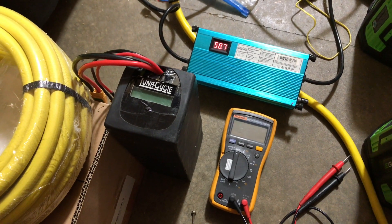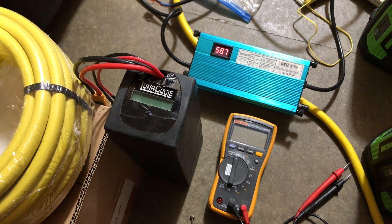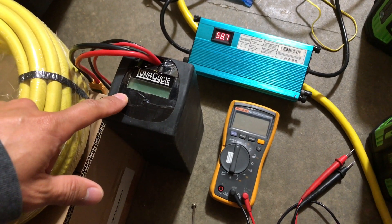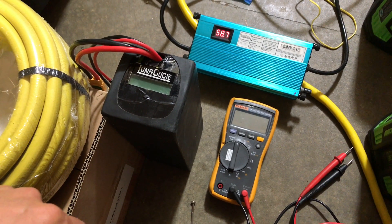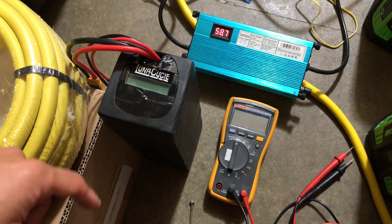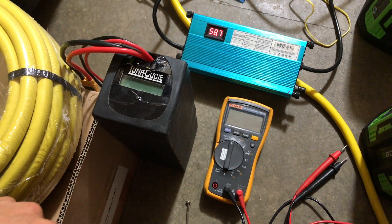What we're going to do today is find out if the M600 and the LunaCycle X1 will take a 52-volt battery. What we have here is a LunaCycle battery consisting of 14 cells in series and four parallel groups. The cells are Samsung 25R, and we're going to find out whether or not my X1 will take or reject the battery.